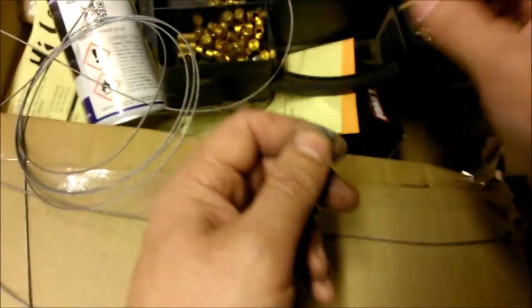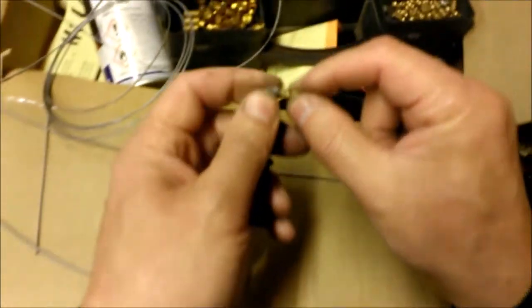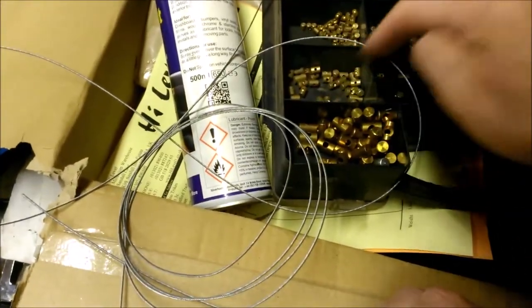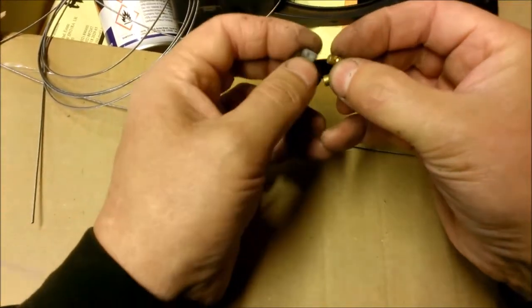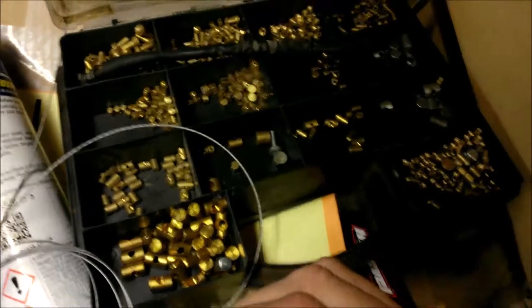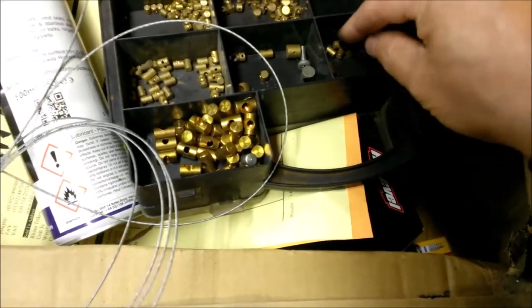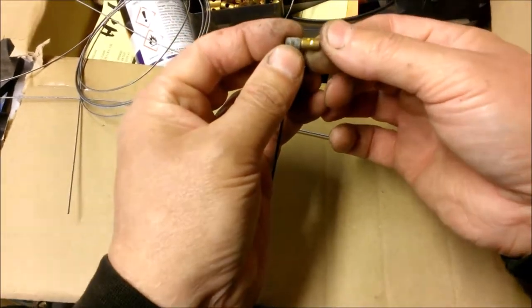But yeah, just getting the correct nipple for the other end. It's always useful to buy a box. You can get them at auto jumbles, or you can buy online. Buy yourself a load of different nipples and different size cable as well. That cable I'm using at the moment is what they call 00, but I think it goes up to 2, which is brake and handbrake cable. On the trikes I use an even wider cable, which I buy specially, which is 2.5mm thick cable.